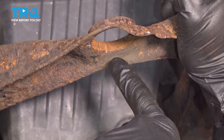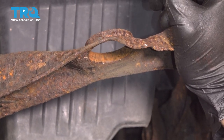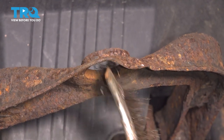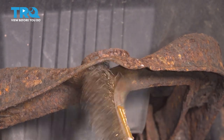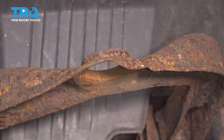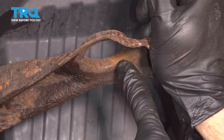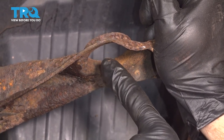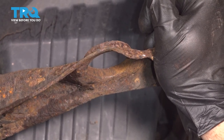Once you have it out of there, the next thing you need to do is clean and inspect the hole in your control arm where your new ball joint is going to go. What you want to look for is to make sure there's no rotted damage in this area. Obviously, when you put in the brand new ball joint, you don't want to have a hole that's too big for the ball joint so the ball joint can move around — it's going to be very bad overall.